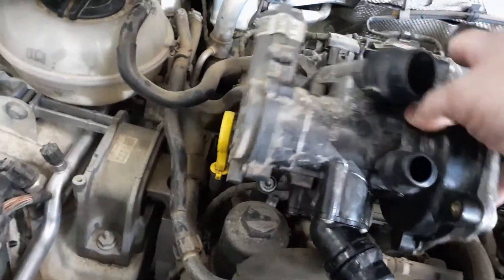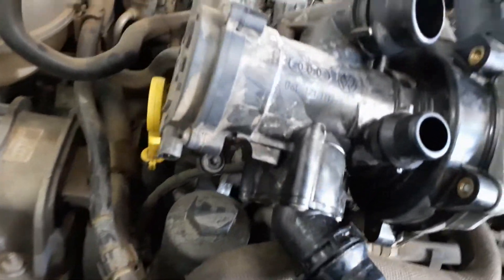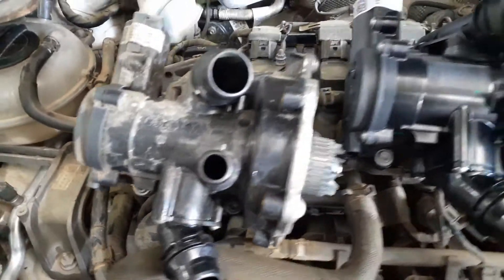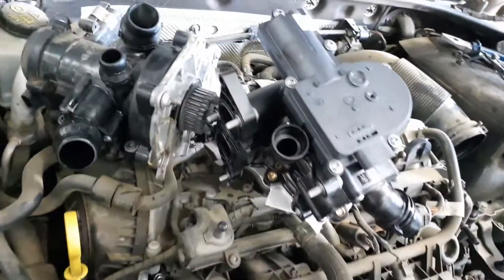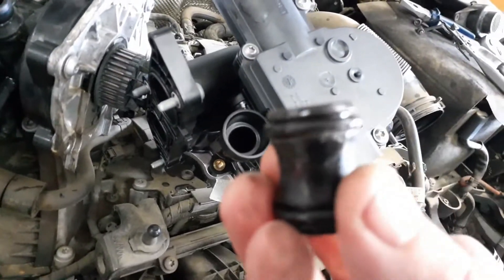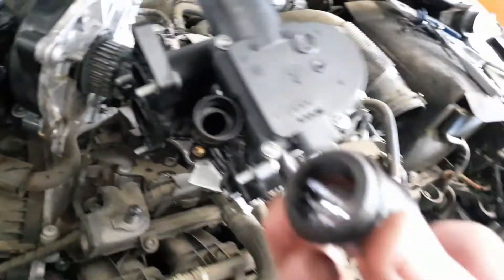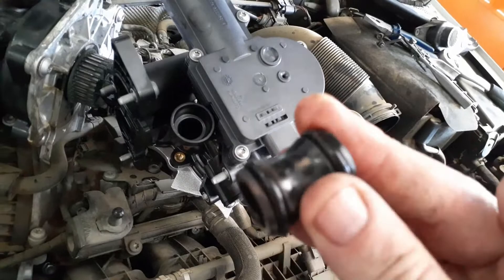You can see this pump has water marks all over it - that's how it was leaking. And there goes the new pump. On the back we have this piece here which fits inside here. What you have to do is replace the O-rings here - we put a bit of sealant because this fits into the back of the oil cooler housing.